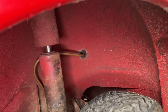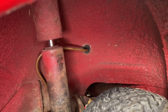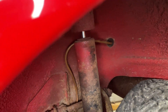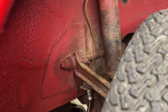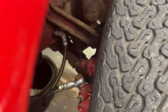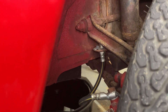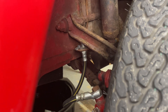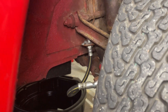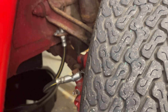In the center of the shot you should see our copper pipe, coming from the master cylinder and carrying our brake fluid. As it comes around past our suspension it connects to our flexible hose, and our flexible hose then connects onto our caliper — because this is a disc brake system — which activates when the brake fluid is pumped through. The copper pipe is static; the flexible pipe takes up the slack as your wheel turns and moves up and down.